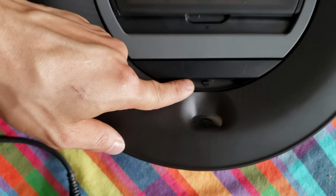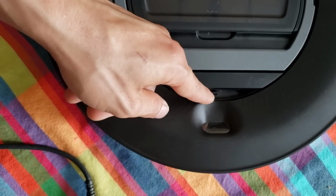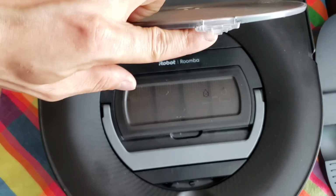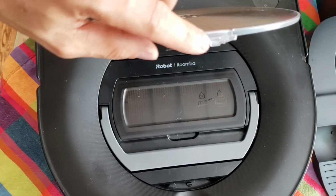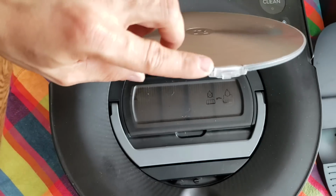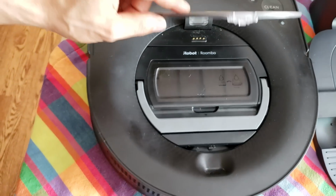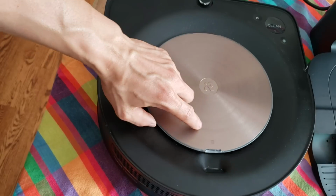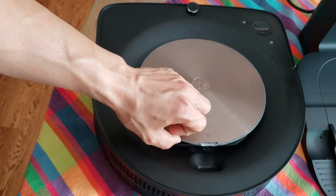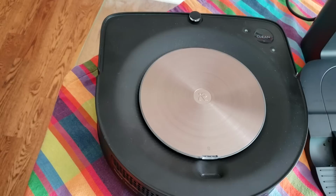Let's go ahead and take a quick look at the latching mechanism. It's basically just a piece of plastic that hangs up, and there's a little lip which kind of locks into here. So theirs might be a little faulty. Either there's not a really good engaging lip there, so it doesn't really lock in there. So that's one thing to look at. But like mine, I don't technically have to latch it. It can just be pulled down by gravity, and it's still saying it's closed.